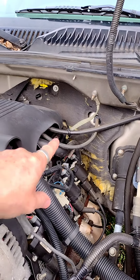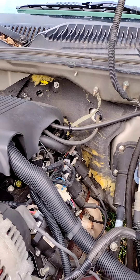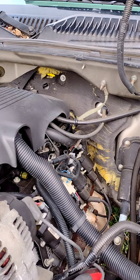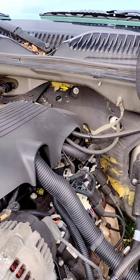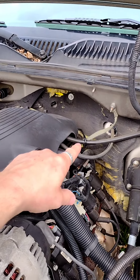I took another single knock sensor and put it on the back side of the engine with the single wire. It worked for a little while — about a month — and then gave the code. With one sensor you get a higher resistance; with two sensors you split that resistance. The computer needs to see two separate resistance readings.